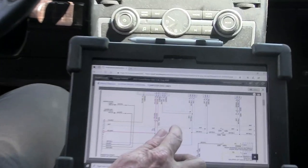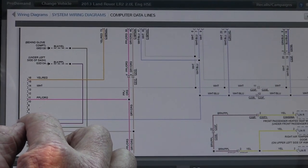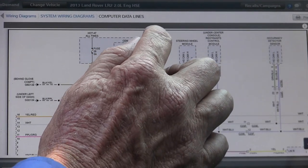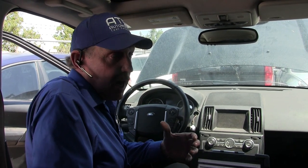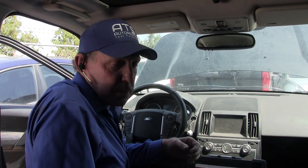The other thing I want to do is look at the medium speed bus. We can see the purple-orange and the gray-orange wires. These two wires come up out of the bus and into my front junction box, marked as MS CAN L and MS CAN HIGH — that's medium speed. Medium speed CAN works between 10 kilobits per second and 125 kilobits per second. CAN C, which is CAN high speed, works between 125 and 1 meg — a much faster network where I can have more activity and exchange more messages. On things that are low speed like the seats and windows, I don't need a fast bus, so those are on medium speed.